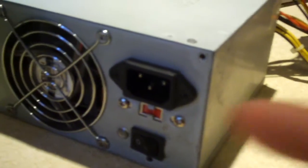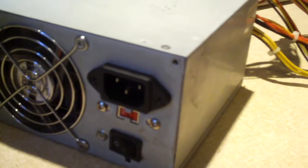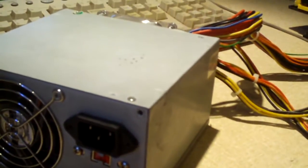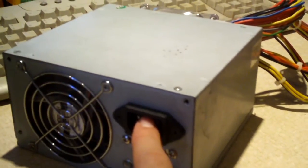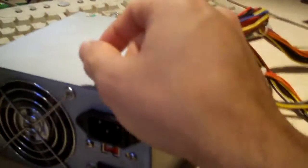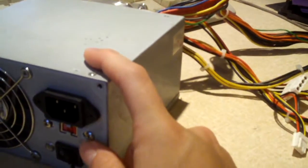Let's say you have a custom built computer, or even an OEM computer that has a power supply with a switch. That switch isn't just there to shut off power to the supply — it's convenient so you don't have to jerk the plug out of the wall, but that switch is there for good reason. You can turn it off, wait for the power supply to discharge, and your case remains grounded. That way you can frequently touch a non-painted portion of the case or the power supply itself, or attach your wristband to the case.